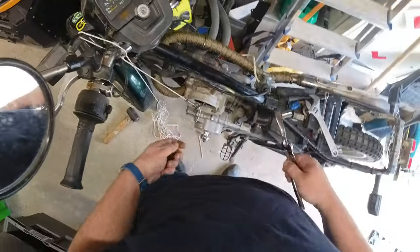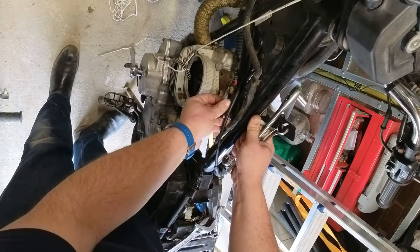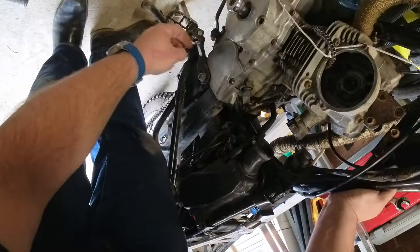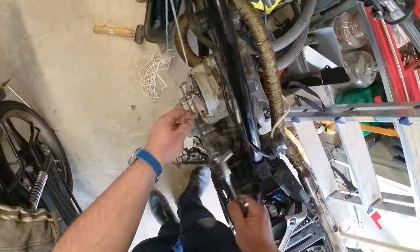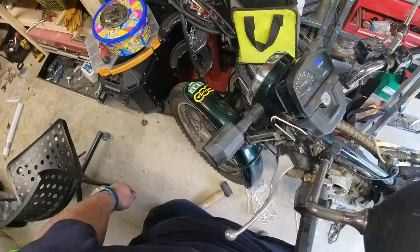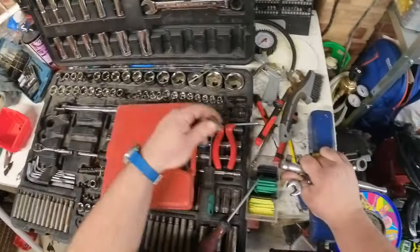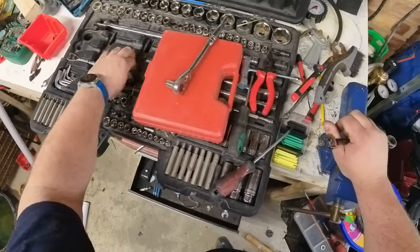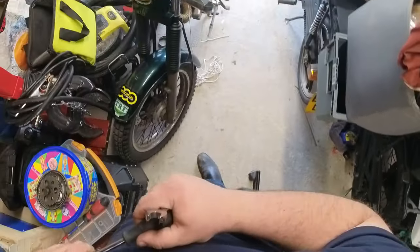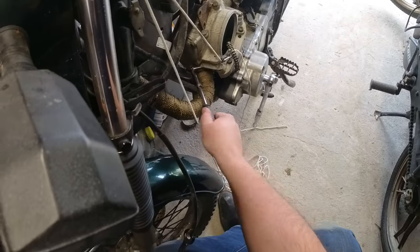That's those apart and I'm just looking here once again to see the order of precedence. We've got four main head bolts on this engine and then two ancillary bolts that sit on the other side of the gap where the timing chain runs. You can see me popping my finger under there to see whether those bolts go all the way through and then just offering up the socket to see what size they are. What I'm going to do here probably isn't recommended - you should ideally take all six bolts out in pattern. The ancillary ones are hexes, Allen heads, whereas the head bolts are standard bolts.